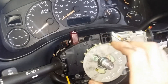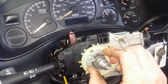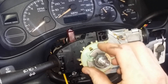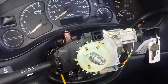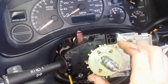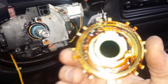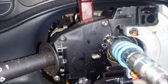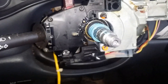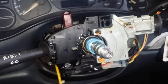Take your tool off and then your lock plate — it's indexed to the shaft and only goes on one way. Take that off and then your turn signal cancel cam can come off. You can see the copper plate that rotates around on the pin for the horn. Once you've got it off you can see your spring that pushes against it — it's a pretty hefty spring. You can leave it on there.